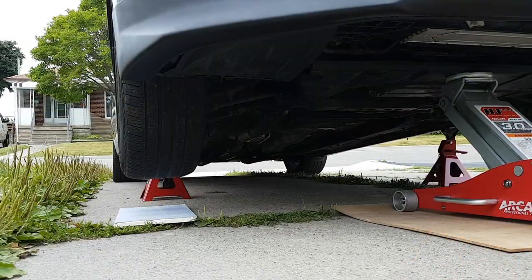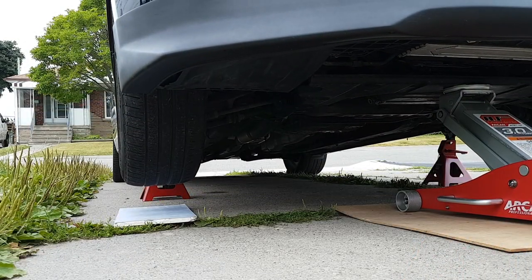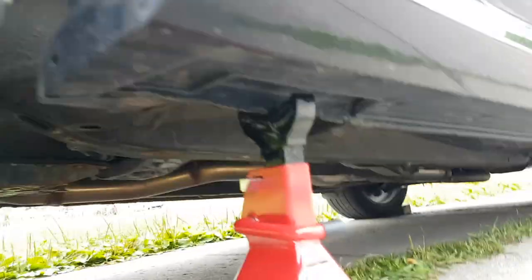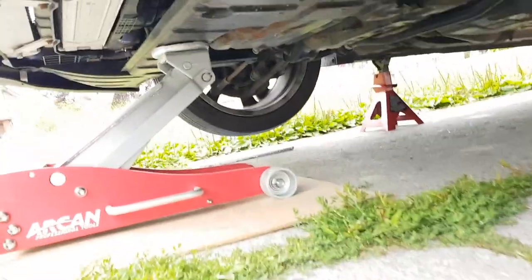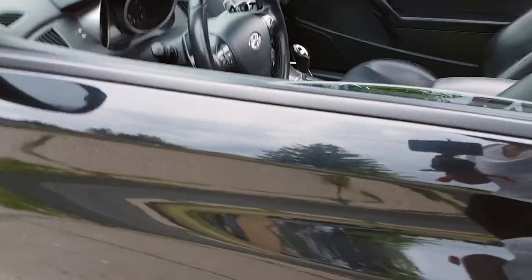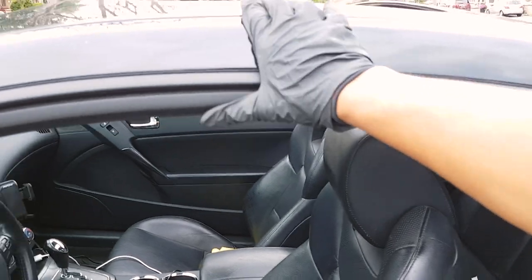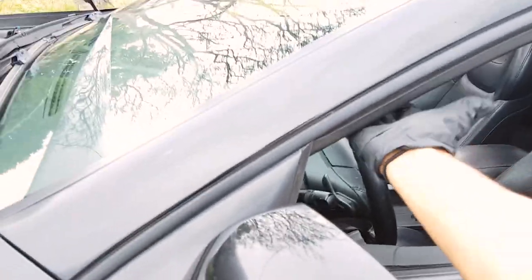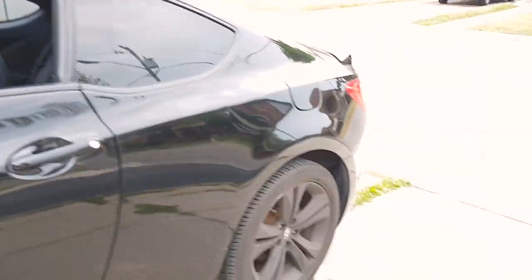After that, lower the car onto the jack stands. The jack stands are holding up the car right at the pinch weld, and the jack with slight pressure is just holding up the subframe. Now push your car — really shake it to make sure everything is solid. If all is good, nothing's going to collapse.